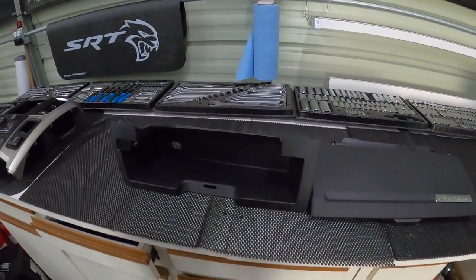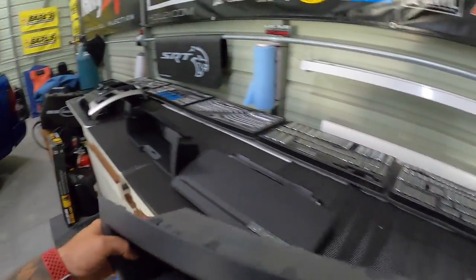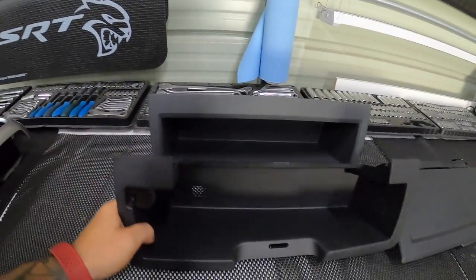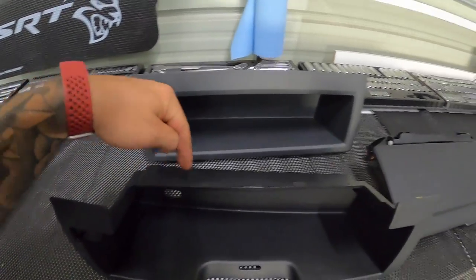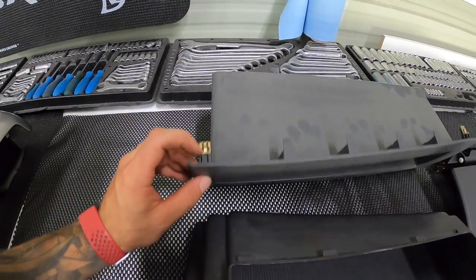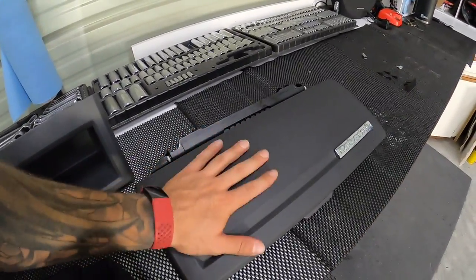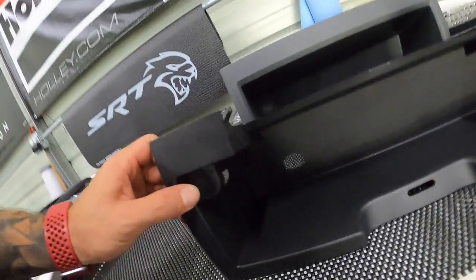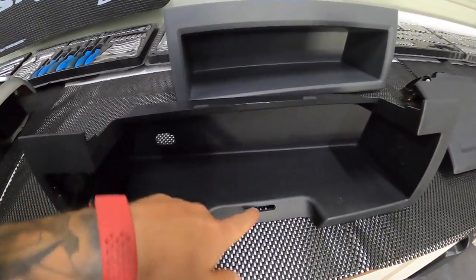Originally you'll have this here, and what you're gonna need to do is purchase these parts because this comes out and then the inner glove box portion goes in. The reason why you need to swap out to this one is because there's a large cutaway portion here, and this is more recessed versus the original — this one is more of a finished trim whereas this one sits in further to allow for the actual glove box lid to be flush with your dash. You'll also see this little switch here, which is for the glove box compartment light.